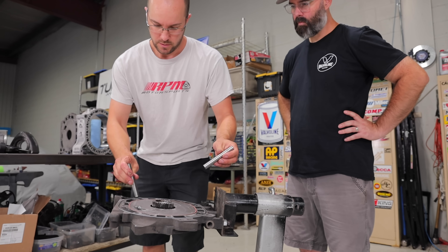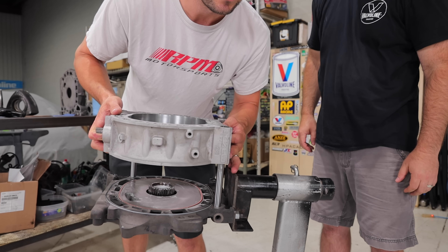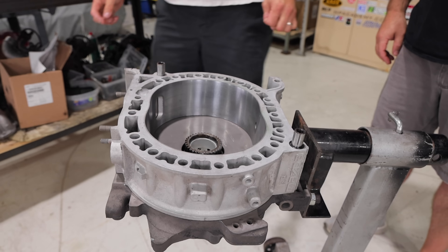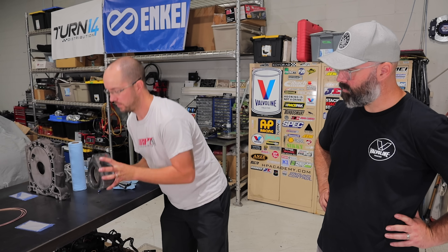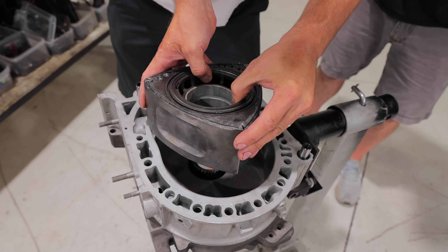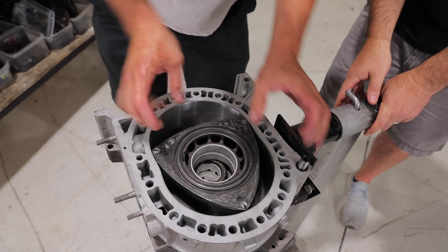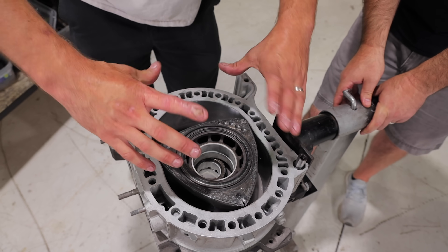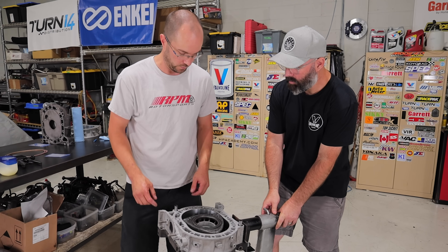There are two dowel pins — one top, one bottom. Joe starts the rotor down on the top dowel first, then gets the bottom dowel on, and it's in place. He assembles the apex seals in the slots with no springs to begin with, then sets the rotor up so that the point is at the 12 o'clock spot. That's preference really — if you set it up so one of the points is straight top, when the next rotor goes on, one of the points will be at 6 o'clock, so they're total 180 from each other.